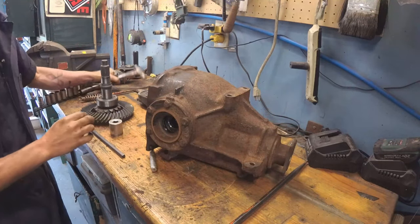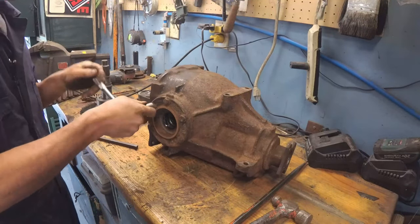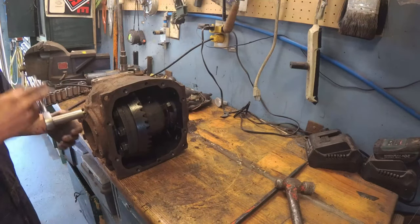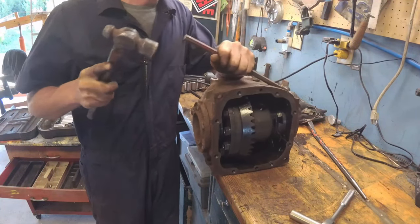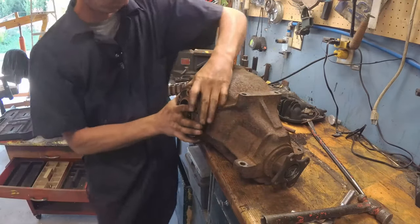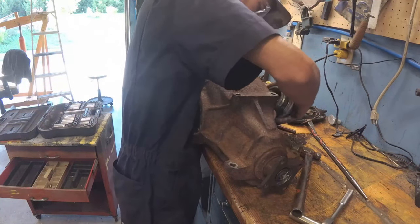The factory diff in that subframe was a 4.10 viscous limited slip. I decided to order some 3.07 gears, disassemble it, rebuild the viscous coupling, and put the 3.07 gears in — but ultimately things went not so good. The pinion fit in the housing and the ring gear fit on the carrier, but they did not match up at all. The carrier did not have enough offset, so it just didn't work — a giant waste of time.